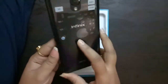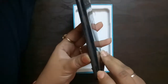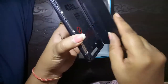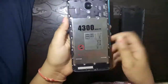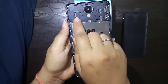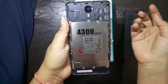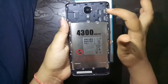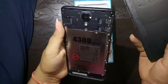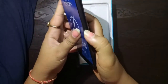Now we will see how to open the back cover. On the left side at the bottom there is an empty notch area — from there you can just pop it open very easily. Inside you can see it again mentions 4,300 mAh battery. Here is the slot where you slide in the SD card, here you enter SIM 1, and here you enter SIM 2. When you power on the phone, whichever SIM is in SIM 1 slot will show as SIM 1 on the screen.